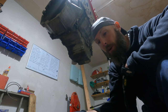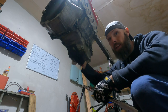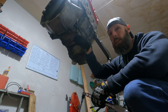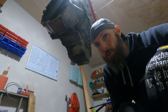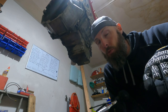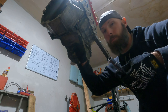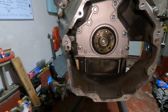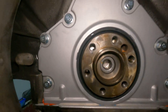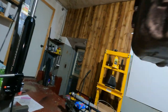Get the bell housing back off and all that fun stuff, get back on an engine stand, and we'll wrap up the video after that. I don't know if there's a torque sequence to this — I've never heard of one, but I like starting from the back, front, front, back, kind of like you're doing a head gasket. I'm having trust issues with my torque wrench because it seems to be going a little too far and I don't want to push it — these things will snap very easily. So I'm going to go by feel but still do the same sequence. That about does it — we're all lined up, flushed down there. Got our rear cover on, rear seal in, barbell's in, oil pan's on. All snugged up all around, double checked everything.